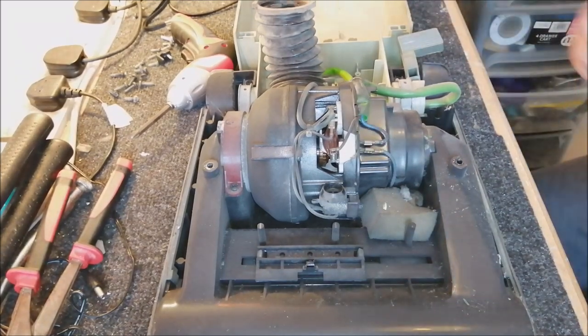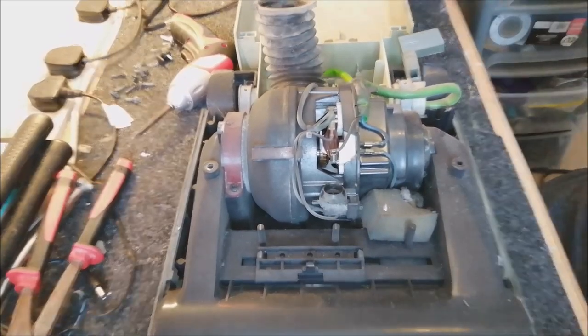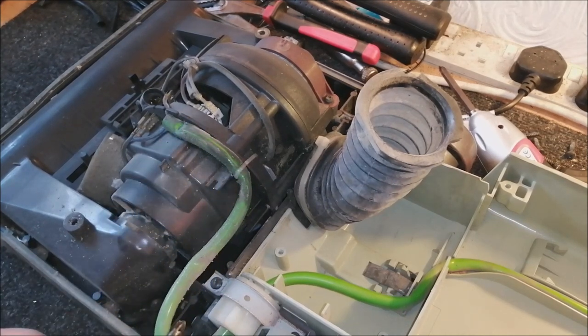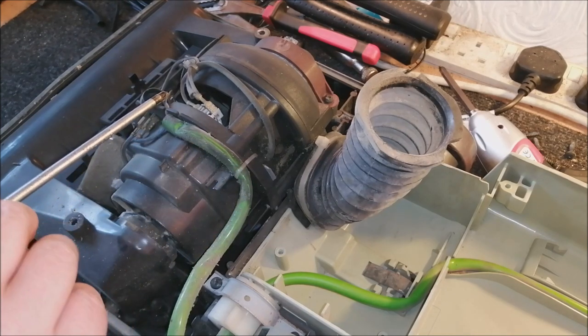It's back there. So this wiring is slightly different to what you normally find, because the suppressor was up the top there where the flex came in. I'm just going to move you a sec. What we have here is a different loom. So you see where the wire, this green, which is fascinating to me, cover comes in. We've got two wires here. We've got a neutral and a live. So live goes to the motor there.